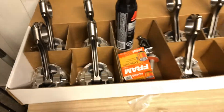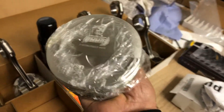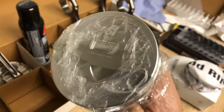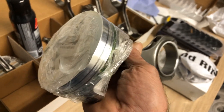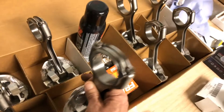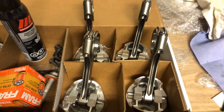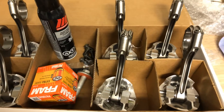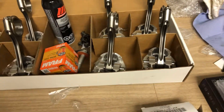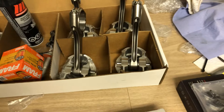When I was calling Summit Racing to buy pistons, I originally ordered the Keith Black forged aluminum - the 4032 forging - but they don't expand as much and are apparently prone to cracking. Those are also 3cc dishes, so with my milled heads I would have had over 12 to 12.5 to 1 compression, which is not going to be friendly on pump gas around here - the highest octane we have is 94. At 11 to 11.3 to 1, the way these LS3 cylinder heads are designed they can handle the extra compression and still run without pinging. And of course I'm running the Holley Terminator X Max fuel injection system, which lets me adjust my timing and fuel ratio on the fly.